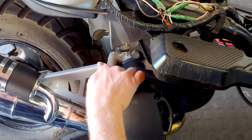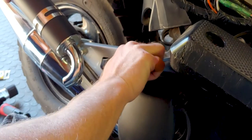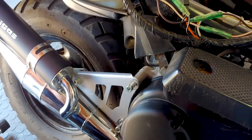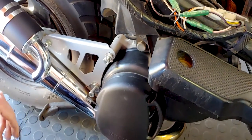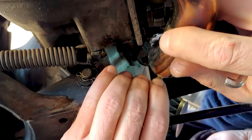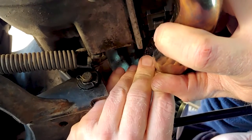Kev is doing just that — seating those bolts until they touch. I've put copper slip on the exhaust manifold bolts. The nice thing about the Technigas is that you still retain the main stand, which on a lot of performance pipes you lose out on.